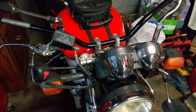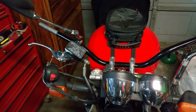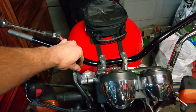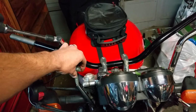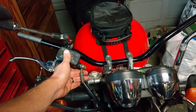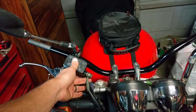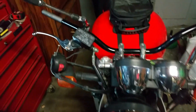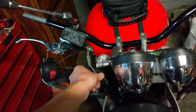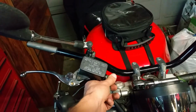Okay, this next thing I'm going to talk about should be practiced with extreme caution, just because it can actually add work later. But what I did in my instance here was actually pointing down this way. So with a 12mm wrench, I was able to carefully loosen it or break it loose enough so that I could move this by hand. But you don't want it too loose or you're going to start losing brake fluid and allowing air pockets inside, which means you're going to have to flush the entire system to get the air pockets out. So I very carefully loosened it and bent it back into position right here, where it is now somewhat loose and isn't being held in a strenuous position. Afterwards, tighten it back down.